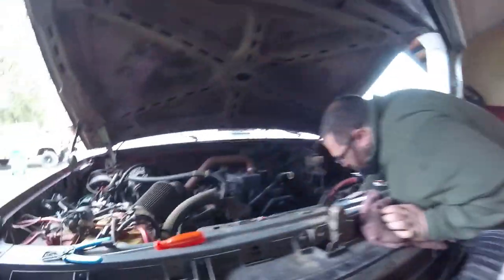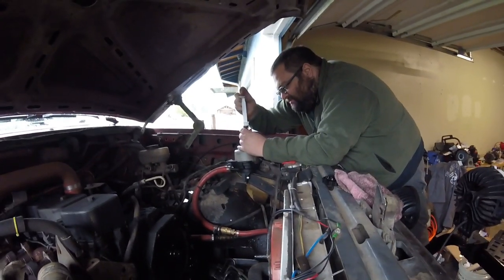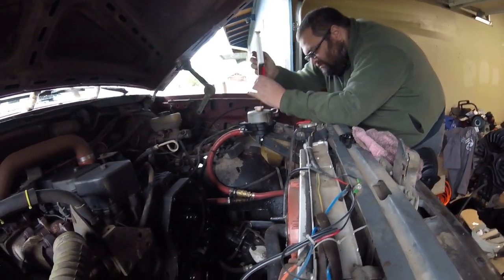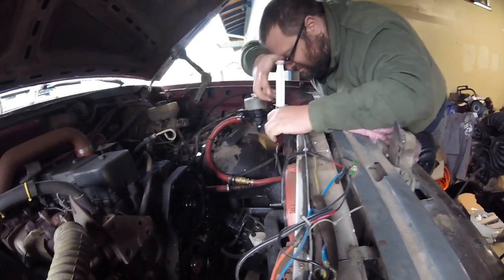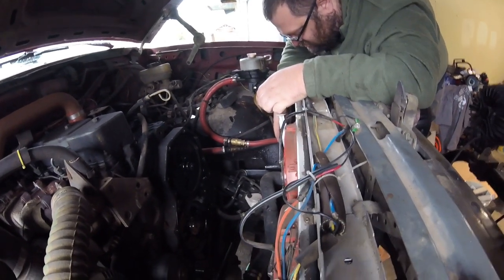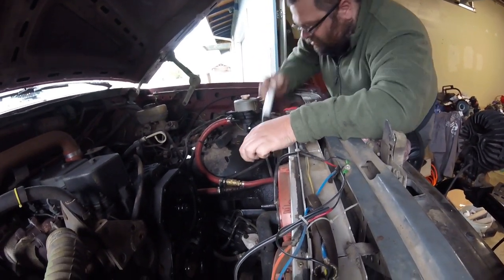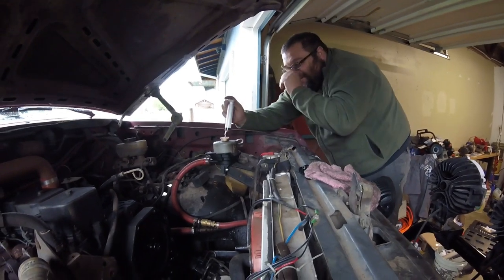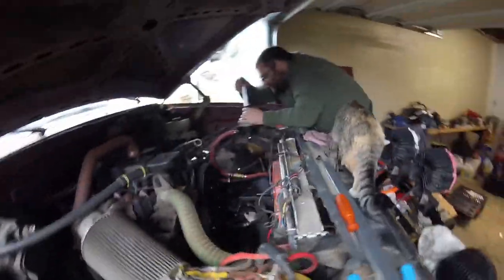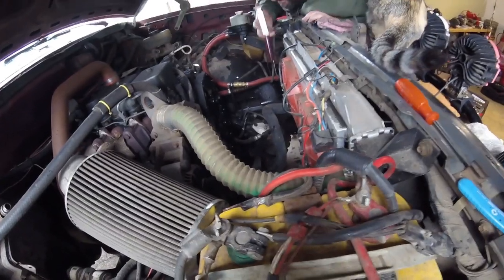So we've just started draining the power steering. Well, he's using the flavor injector to pull that fluid out of that reservoir there. We're going to be getting rid of a lot of that piping because we have a more simplified power steering pump setup. The cooler thing we're going to have to come back and deal with later, but I think for right now he'll be okay since he has the Saginaw pump. And you haven't really had any cooling problems? It used to be the engine cooler for the 351, right? Yep. Redhead steering gear treating you all right? Oh, wonderful.